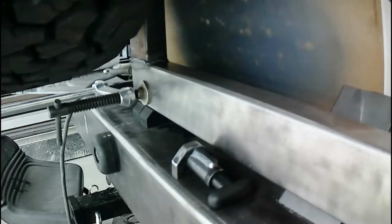And while I'm pulling in with that, I've got another bracket mounted here. Can't really show you with the clamp. I'm going to cut it down a little bit. I can always shim that boat bumper out. And I'm going to weld that on there to give it some rigidity that way, so it's not in theory working just on the hinge pin way over here.